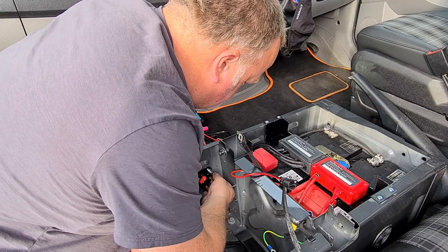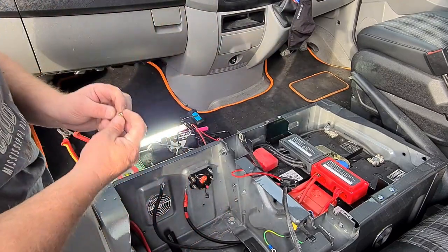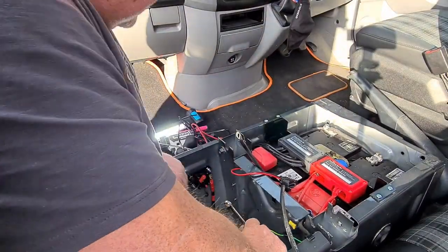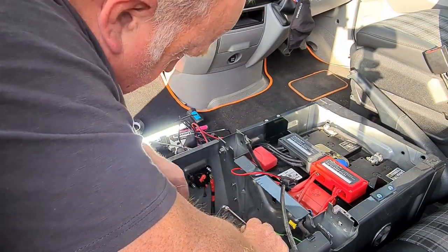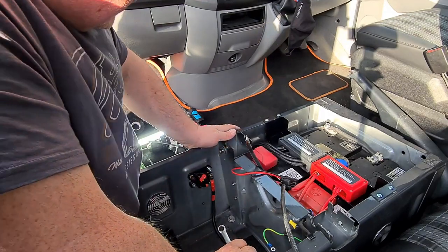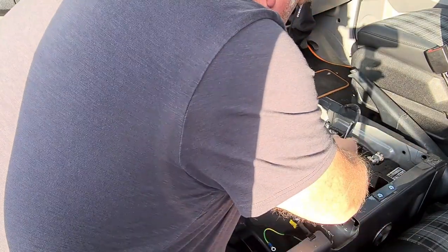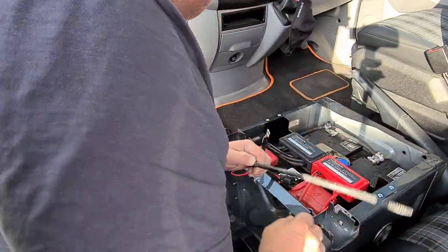The plan is to do all the install work first, put the cable in, and then when we come to put the inverter in it's just a matter of two connections. When you're installing your battery links, consider where you're going to run these cables — you don't want them to be chafed or damaged. What I try and do is use the cable ducts already built into the vehicle and cable tie the cables to other cables in that area. This will help protect the cables from movement and vibration.